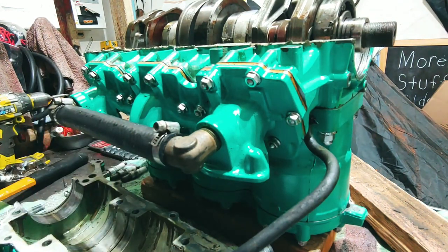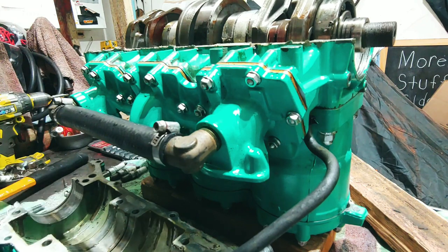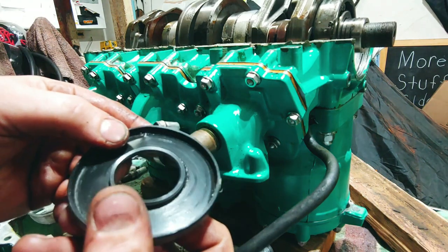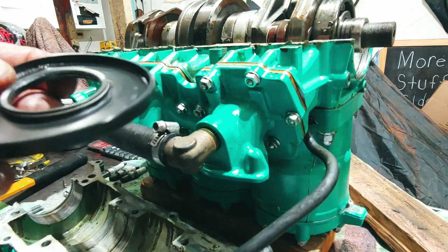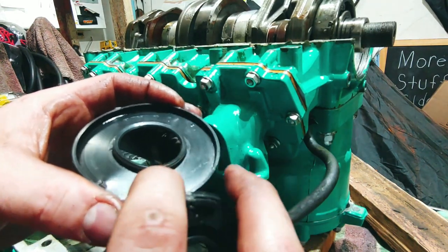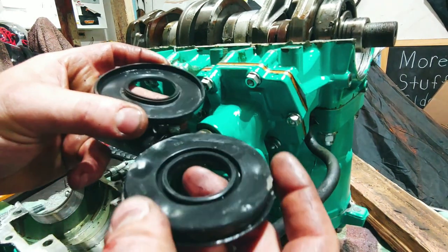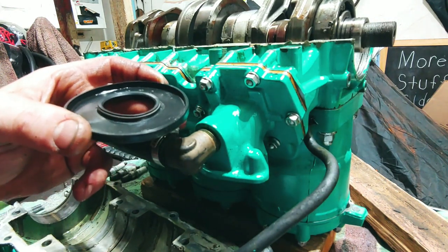And the last one, which, gosh, this thing was covered in grease. Awesome, TNT. Okay, so we're at 1228. What was this one? 1229. Yeah, so this one's 1228. Also 35 inner, 80 outer, 6 thickness, and a 1mm lip. Oh, actually, that one's more like a 0.5mm lip, I would think, because it says 1. Well, no. It would say 81 then, because this one's 8084. It's 80 outer diameter, and then the lip's outer diameter is 84.